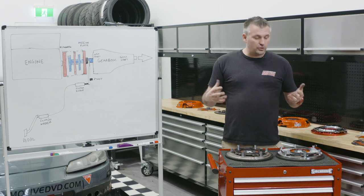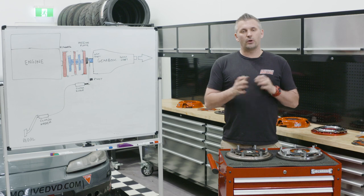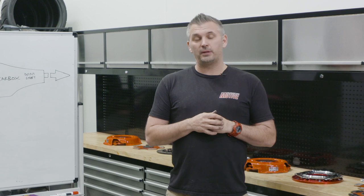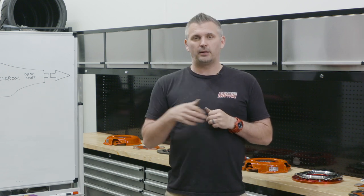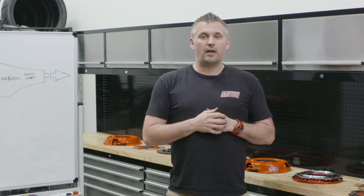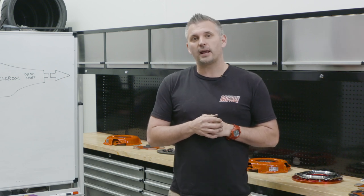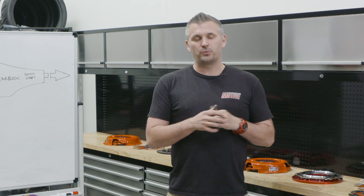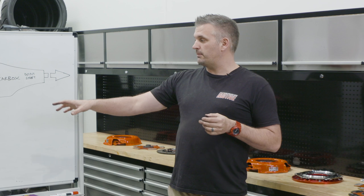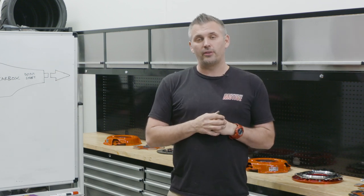That's the whole point we're getting to with clutches — you just can't always have your cake and eat it. You've got to work out how to balance what you need for your car. If you're all about lightweight because you want to go around circuit, that's one type of clutch. If you're all about drivability, that's another clutch. If you want a compromise between a car you can drag race and drive on the street, that's another clutch. It's just a massive balancing act between the pressure plate — how much pedal pressure you have — and then you can do all the adjustments in your clutch master, clutch slave, pivot point, and even your throw-out bearing to get all the leverage right to determine how hard the pedal is.